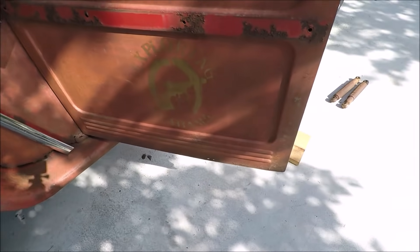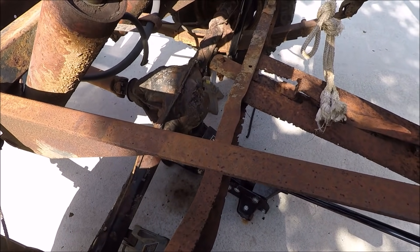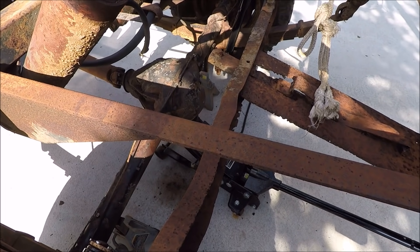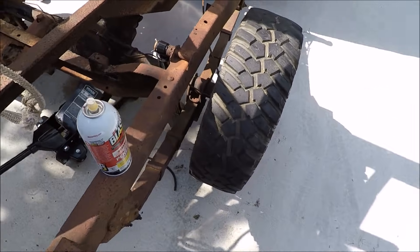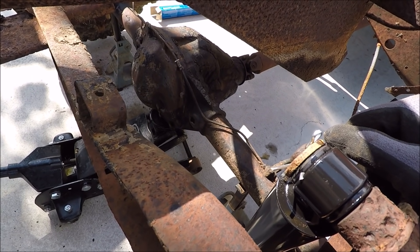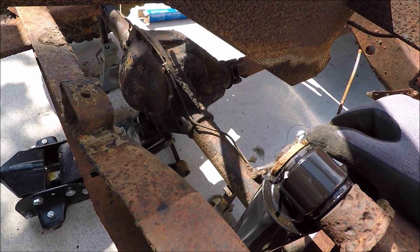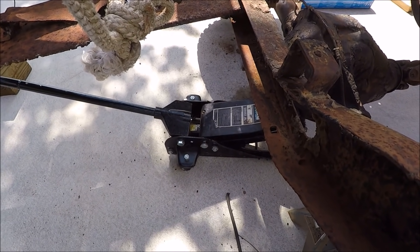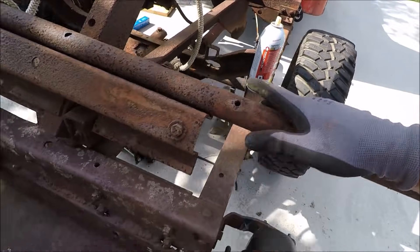Let's put this thing on the ground and see if the tires held their air. I almost put it on the ground but I'm glad I didn't - I'm going to change the fluid in the front and rear differential first. I need to look up how much goes in there because you don't just slap fill it up. On my old '78 CJ5 and my Commando, you can only fill up to the drain plug and that's it, so I need a tube or a hose to pour. I notice a grease fitting on my jack - I've never known that. It's looking a little dry down there.